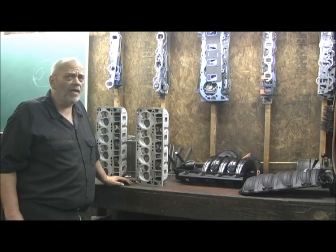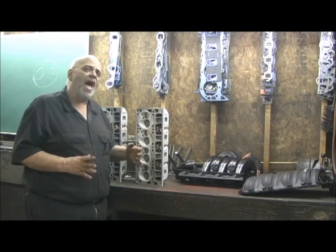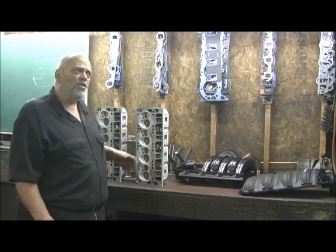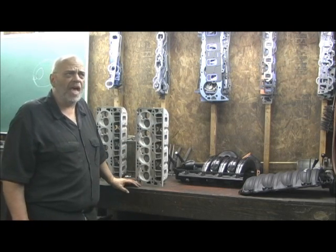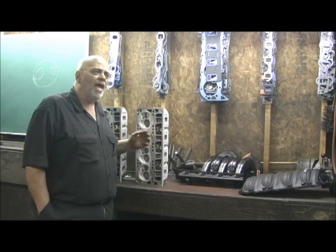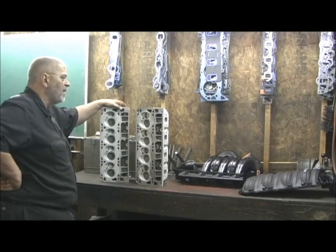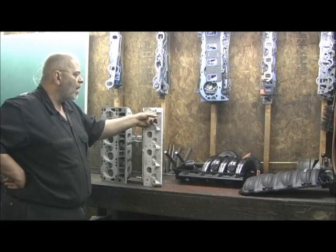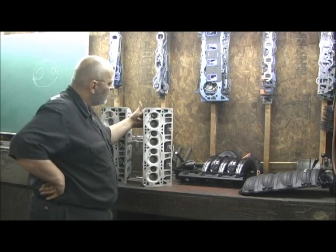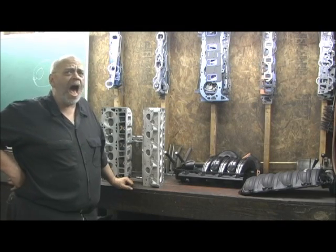There's quite a bit of porting I can do to really turn it into something, but not near as much as the old school stuff. If I had to say there was a defining difference in the heads, it's going to be the horsepower gains that I'm going to get versus the amount of effort I have to put into it. When I've been working on stuff for years that had real low elevation angles and had to change bowls and do all this stuff, it was really a delight to work with something that already had so many good engineering qualities. If we turn this around, look at that exhaust port. I used to do my middle finger test to see how far my middle finger could go down before it touched it, and I mean, 10 or 15 years ago this was all out high dollar race territory stuff.